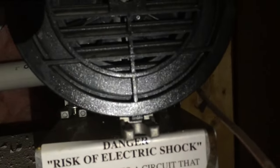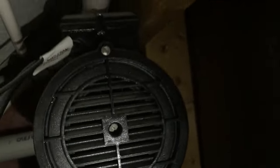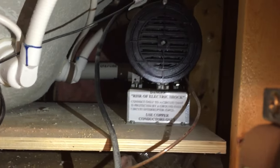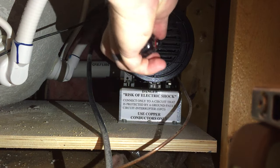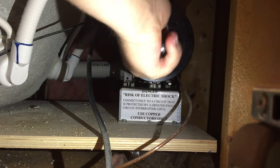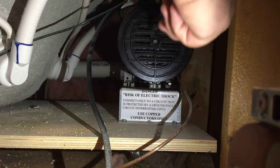On these particular motors, there is always a screw in one end of them. If you look in the center right here, you can see there's a flathead screw — actually it's a post that runs the full length of the motor, and that's what the impeller is attached to. By turning that flathead post with a screwdriver, we can loosen up the motor and hopefully loosen it up enough that it will kick on.